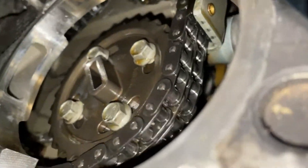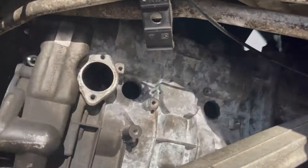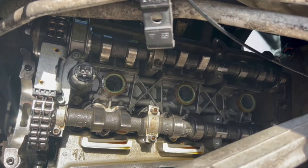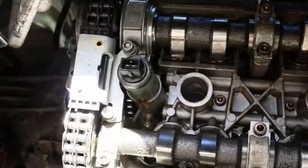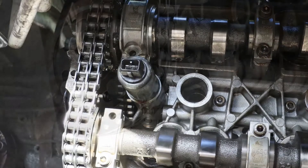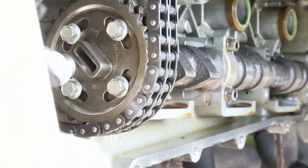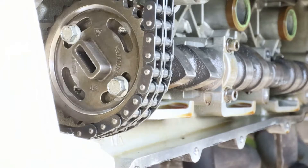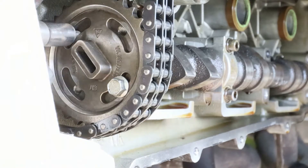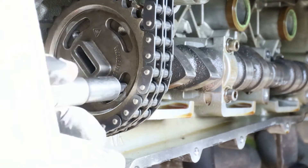That's why she's not running. It's obvious what's happened — chain tension has failed, the chain jumped, or the sprocket jumped on the chain, causing the pistons to hit the valves. I then remove the chain runner, drop the sprocket off the exhaust cam so I can drop the exhaust cam out without worrying about the chain. I then move to the inlet cam, drop that out, and we can drop the head off to see what the damage is.